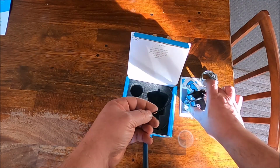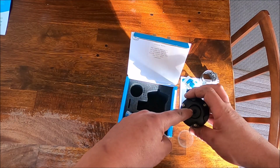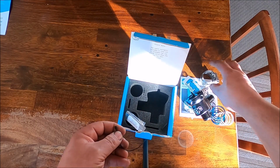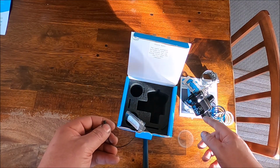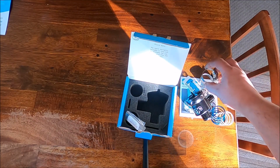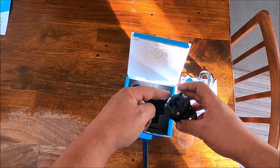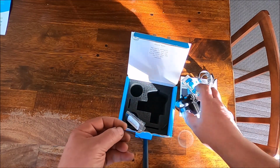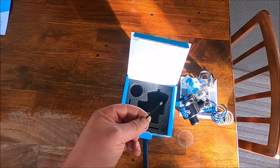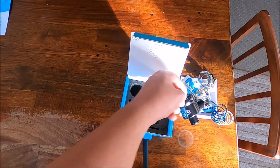Cable tie, that's obviously for the top because there's no real jubilee, is it? Go tight enough on a hose like that. And there's no need anyway, because another thing worth mentioning, the bigger the pipe, the better the clamping needs to be to hold on for any given boost pressure. So on very small bore things like vacuum hoses, almost always, in my experience, even at 30 psi plus, it's not going to pop off even with just a cable tie done up tight.